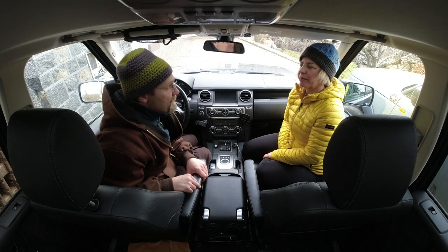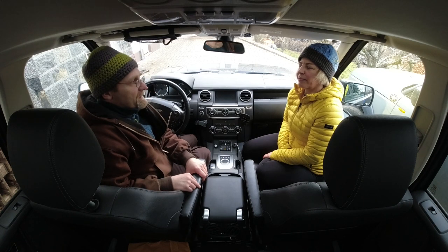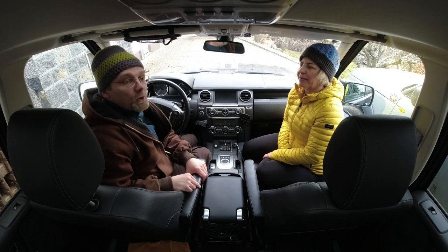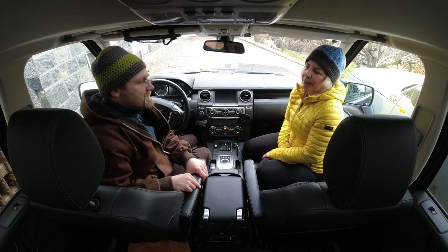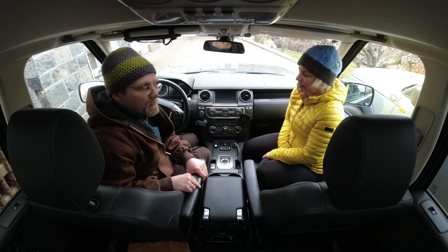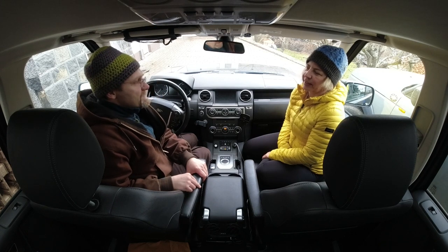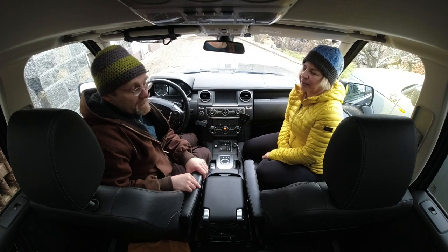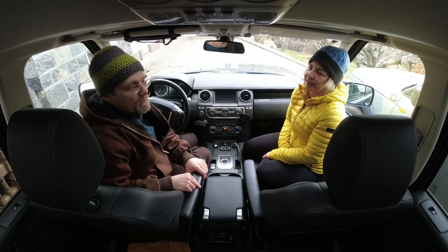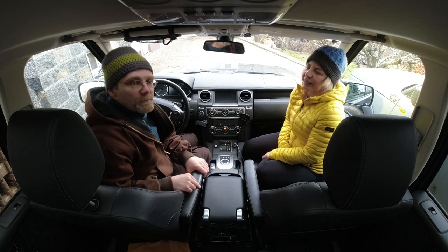When this vehicle has any kind of fault it will result in the air suspension lowering down, and that's the reason why people get annoyed — so annoyed that they actually remove the air suspension and put in coil springs. But it's not a problem of the air suspension; it's a problem of the ECU. Whenever it has some kind of fault, it thinks 'I better get that vehicle into limp mode and restrict the engine power so the driver doesn't do anything stupid.' That's the problem, and that's in general one of the biggest problems of a Discovery 3.